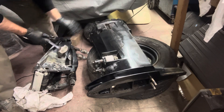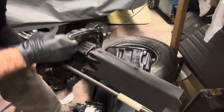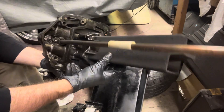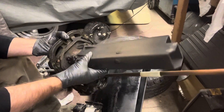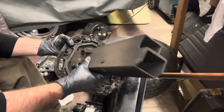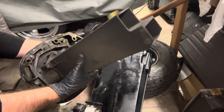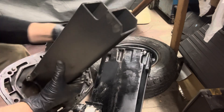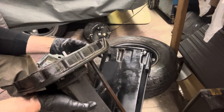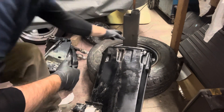There's another bolt I don't see. Now we can also inspect this — I see this is loose. I'm going to have to look in the book and see if there's a gasket in there, or if that can just be tightened up. I see a broken piece in here — we'll have to weld that up. Broken bolt on there, probably isn't causing any harm — it's just sending the exhaust down and out. We'll get a new gasket for this. We can see our tube for our water pump, which is in good shape — nice to see, so we know we'll have good water flow. All in all, it's good that we took this apart because now we're going to make some more repairs.